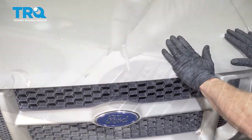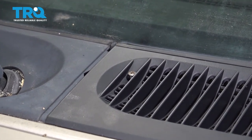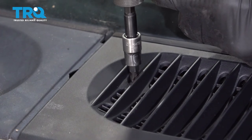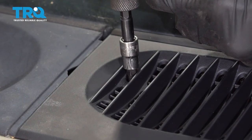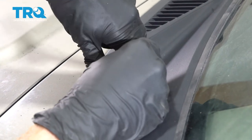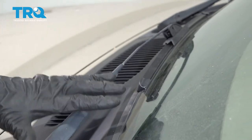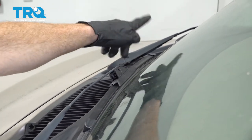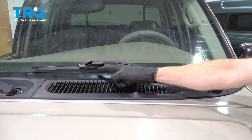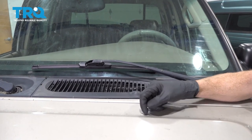Let's close the hood and make our way up here to start putting in our Phillips head screw — snug it up. The lock should get into the locking position; then rest it against the windshield and make sure it's in the proper position. You don't want it sitting halfway up the windshield. Okay friends, we got our wiper cowl installed. The process for the other one will be the same exact thing as this one. Thanks for watching.